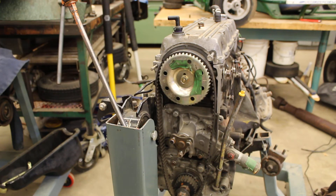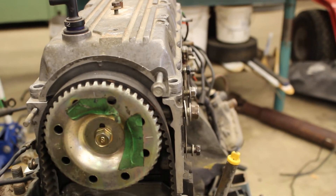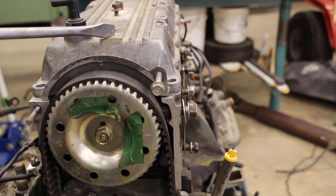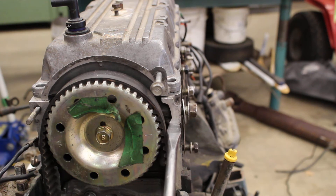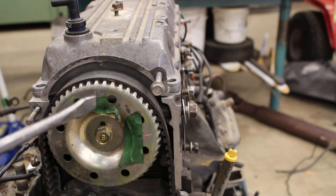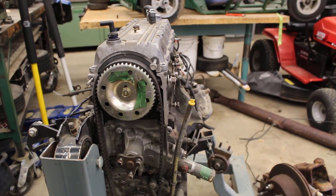Make sure the crankshaft is in the correct position, then time your camshaft. The camshaft timing marks are up front here — there's a line on the cam gear right here and an arrow on the camshaft cover. There's another line on the gear over here, and also a little arrow cast into the side of the block up there. So you've got two marks to ensure the camshaft is lined up correctly. When you replace a belt, be careful that when you add tension, the camshaft and crankshaft don't rotate out of time.